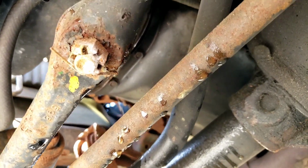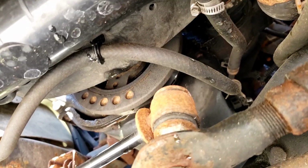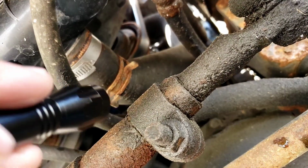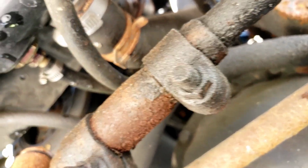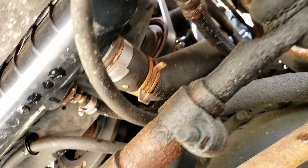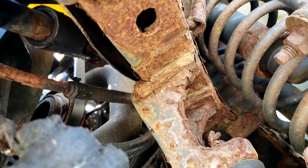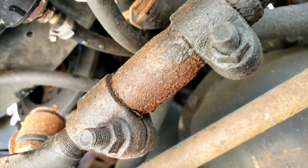All right, so you can't see anything from underneath. You can't see anything from the top. But it's definitely down the middle of the engine, which is the crankshaft. So most likely that is the water pump. All right. And look at this. When the guy did the radiator, look, he didn't remove the old clamp. He kept it. I don't know. Wants to keep it as a spare. I don't understand that point. But anyway, listen, when you sell somebody a radiator, you got to sell them the upper and lower radiator hoses. That's just something that you just do. All right, because they're attached. So, if it was leaking from the lower hose, okay, you follow that lower hose all the way around, it will be dripping onto that power steering pump, and then it'll be coming from that bottom pulley of the pump. So we know it's not the lower radiator hose. So it's definitely the water pump.